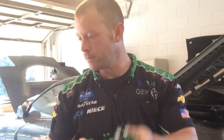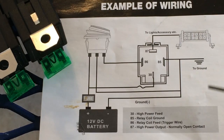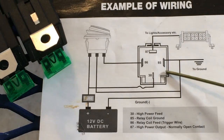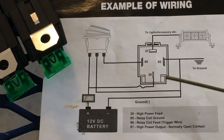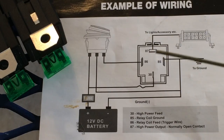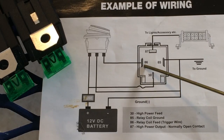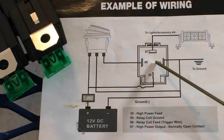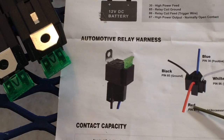So let's discuss the wiring situation of these. This kit did come with a wiring diagram, which is usually pretty helpful. This isn't a deep dive into why and how to use relays, but it does show the basics of how to wire these. Your 85 is always your ground. Your 87 is what is going to power and trigger your accessory. Number 30 is always going to be your positive to battery. And your 86 will be from the switch — or in my circumstance, it's going to be my ground lead from the ECU, as these are going to power my electric fans. They also show you a colorful diagram which helps.